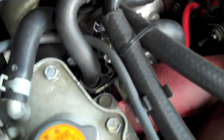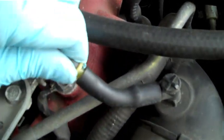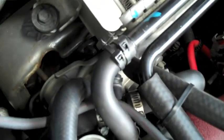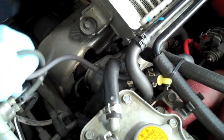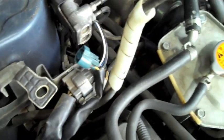To remove these it's pretty easy. At the compressor housing, there's also going to be a line that runs up into your turbo inlet — simply pull that out, it doesn't require too much pressure. Now all of your lines are going to be disconnected. Just gently pull out the rest of that routing.